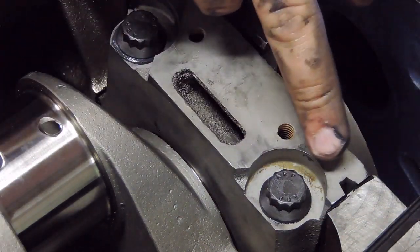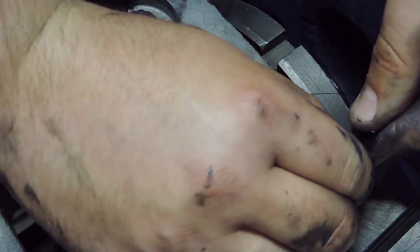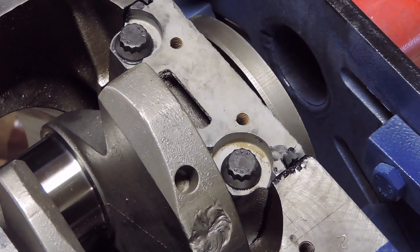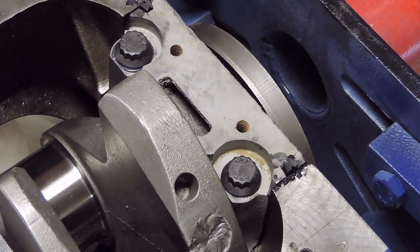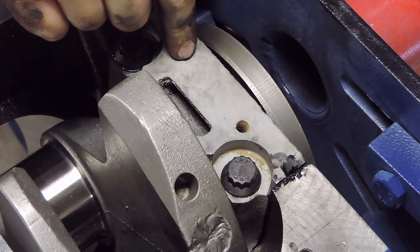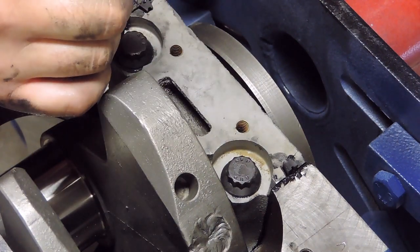So with the wedge covered, what you can see is there's an opening here in the cap against the block. You're going to want to press this down into the cap as far as you can. So I will press that in and bring you guys back. Well, inevitably, with the blessing and grace of technology, the camera decided to quit recording. And to be quite frank, I'm not going to take this main cap off just to show you guys how to install those seals. So what I ended up doing was I put RTV on both of these seals, slid them in against the block and the cap, down as flush as possible. Preferably you want them all the way to the bottom, but I'm hoping there's enough of a seal there that I don't need to do that.